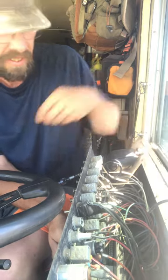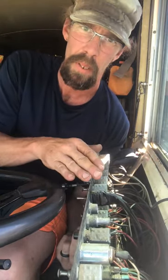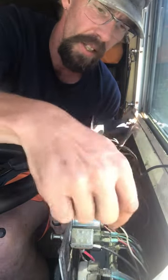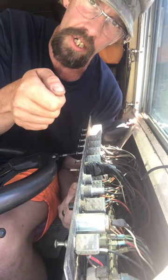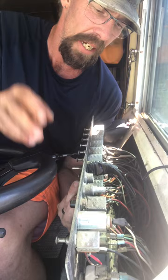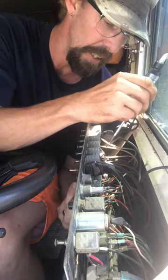I'll go right on my window ledge. I always advise that you hold this up — don't rest it down — because right down in here at the first set of switches, you can see all these terminals are exposed. You'll touch the metal and you don't want to short anything out. With a lot of school buses the key works both ways: full power to start the vehicle, or the opposite way just turns on the battery. So I'm going to turn the key one way and check my terminal.